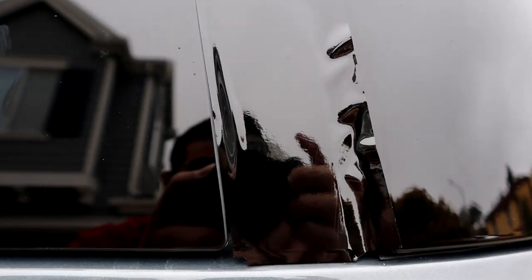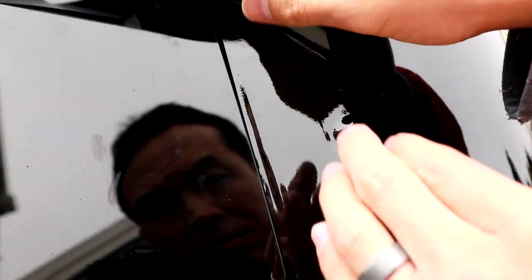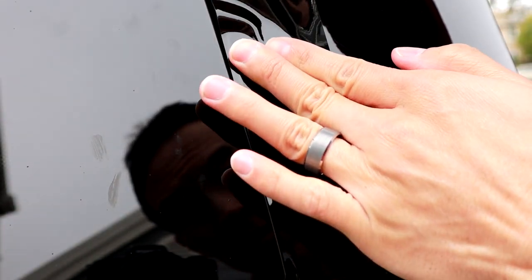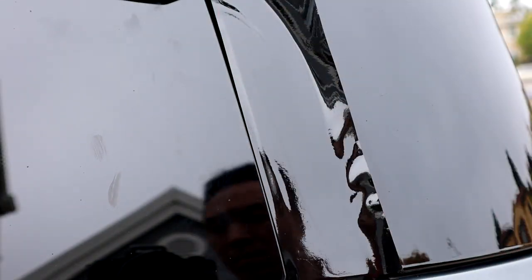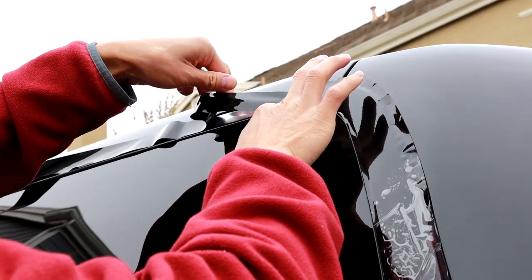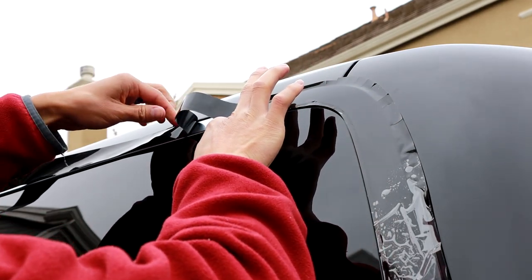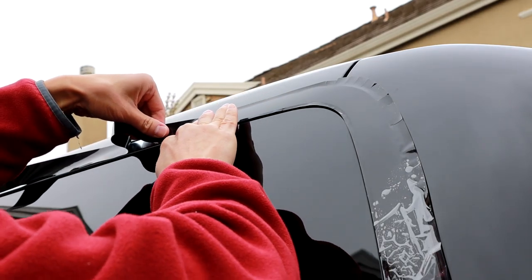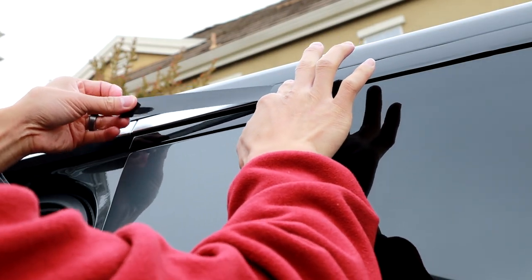For this piece, line up the bottom right with the paint. What I did is line it up with the window on the left side, just inside the window, and then work your way up. The other side of the trim is really big, so this is the easiest way to do it on this left side. Go ahead and line it up — you can see the film there too, so you want to start that later if you can. I'd highly recommend opening your lift gate as well; it makes it easier. Go ahead and work your way all the way across, and after the curve, line it up with the top paint and go across.